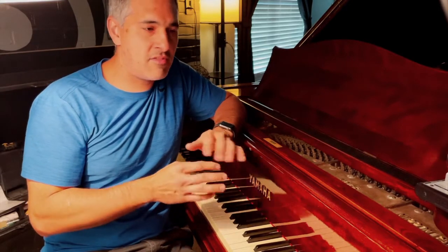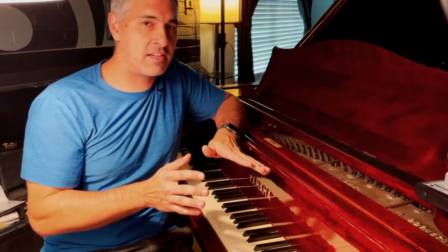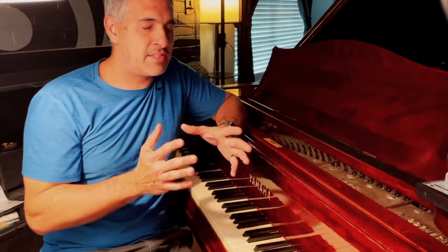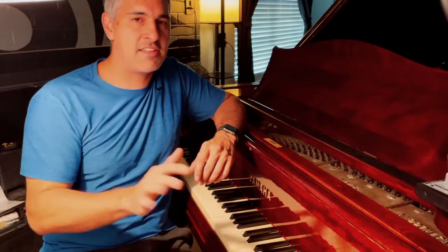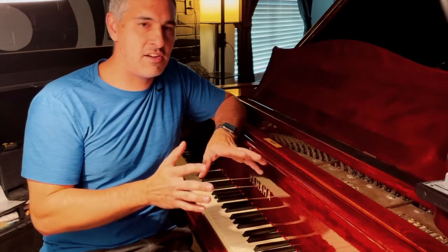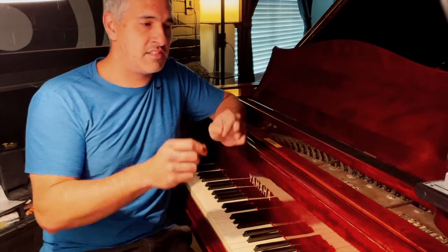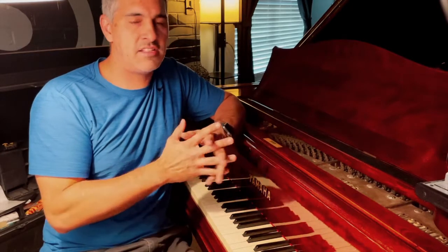I want to cover everything up that's not getting painted because that overspray is so thick, especially with a good two-part clear coat like your automotive stuff and things you'd paint your car with. It's so thick. I mean, the overspray gets everywhere. If you've got exposed glass or anything like that, be ready to have to clean it off if you're not covering it up. So make sure you take some good time to tape really, really precise, everywhere that you don't want the paint to get.